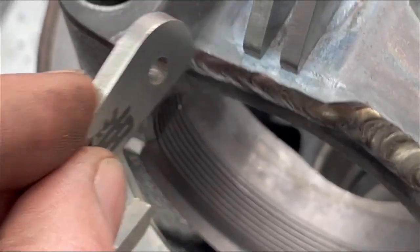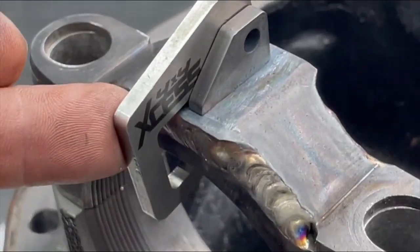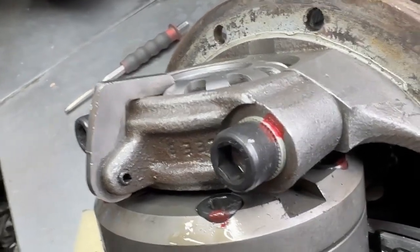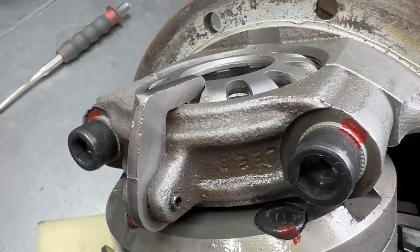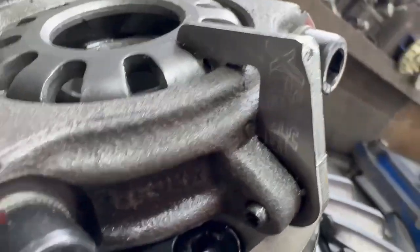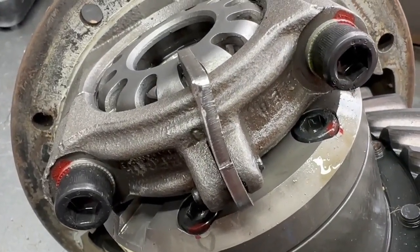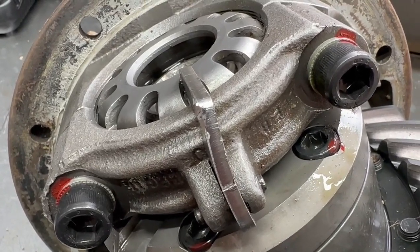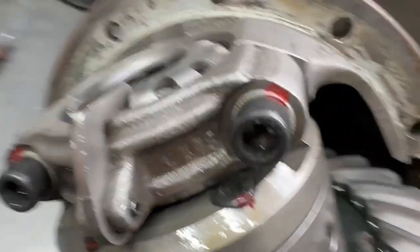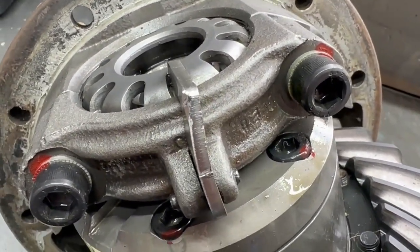We use our own CS80 ears, and those ears drop in to this unit and lock into the adjuster ring — and that ain't going to move. Regarding the Domex carrier cap conversion — this diff has just landed on the bench where a half shaft has broken. That is one of our CS80 ears, as tough as old boots, and it's bent that really hard. That is well out of alignment. So please — that silly little 3mm hollow cotter pin would have sheared off and more damage would have been done. This actually proves the point that that pin ain't strong enough.